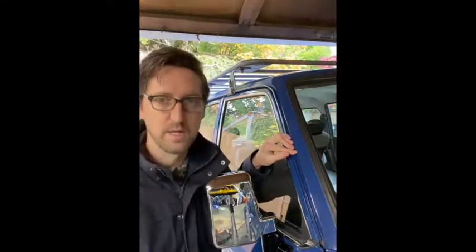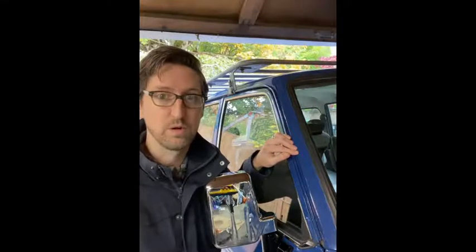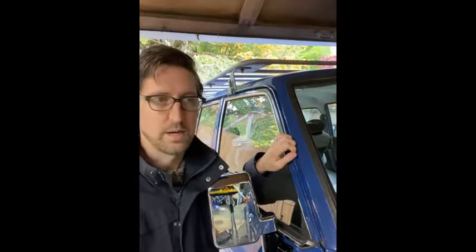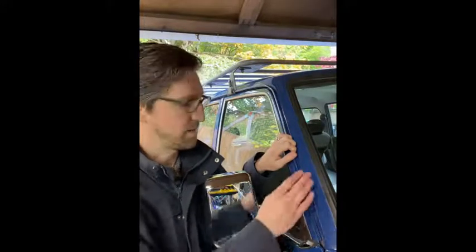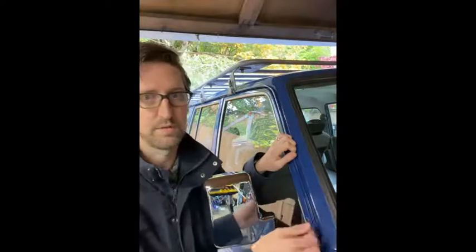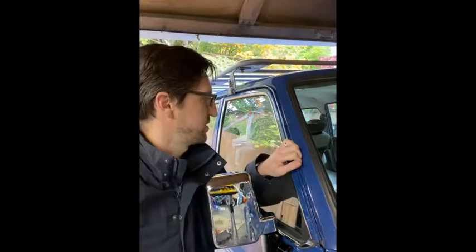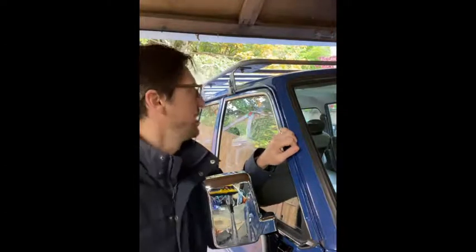Really make sure that you pick a seam sealer with a cure time that you can work in, and really go through and clean this really well. Again, this applies to all the different series. Even though I'm talking about the 60 series, the 40 series also uses a seam sealer over their fiberglass to metal rivet gutter system, and the 70 and 80 series use a similar gutter. I think the 100 series uses a totally different gutter system, so we don't have to worry about that.